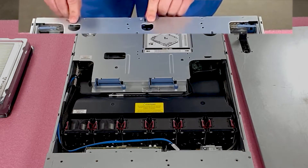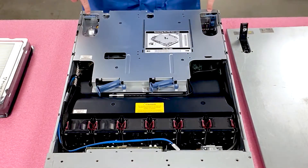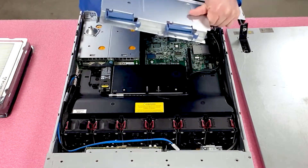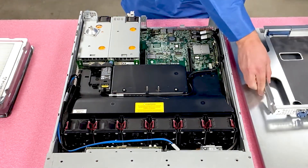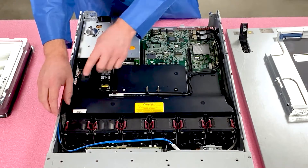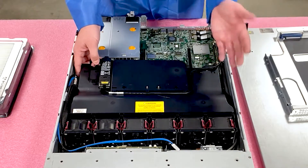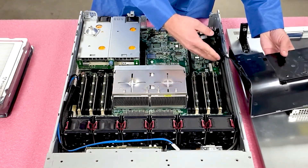Sometimes people miss the middle one. These two clips right here come down. After that's done, you simply pop these open, and then there are these little latches right here that you pull up. Be careful because there is a PCIe riser board on here that is inserted, so you come directly up as opposed to pulling to the side or pulling back — you could easily accidentally bend the leads. Then simply remove the air baffle or air shroud. You'll notice there are some cables on the right side, so do be careful. For the sake of time, I personally just pull it out and toss it to the left a little bit so the cabling is still all intact.